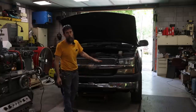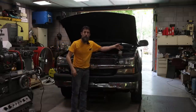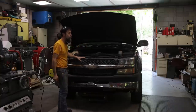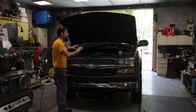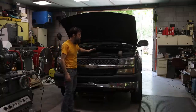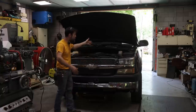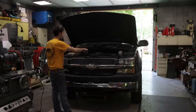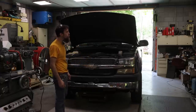All that stuff you get if you get the entire vehicle — that is, obviously, if you have the space to store an entire vehicle. That's not an option for everybody, I understand. But if you can, buy the entire vehicle. If it's wrecked, at least you know that it ran to the scene of the wreck. 4.8, 5.3, 6.0 — doesn't make any difference, they're all great engines. Just get an entire engine and you'll be much better off. Make sure you get the wiring harness, the computer that came with it. And if it's drive-by-wire, make sure you get the throttle pedal and the TAC module. The other added benefit to buying an entire vehicle is that I can part out the hood, grill, headlights, core support on Facebook Marketplace and make some of my money back. I bought this entire vehicle for about the price I'd have paid for the engine anyway. Buy the entire thing and you will be happy that you did. You've got the fuel tank, fuel pump — you name it.